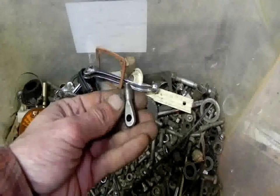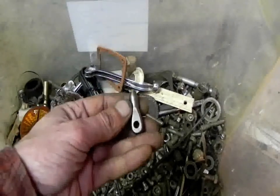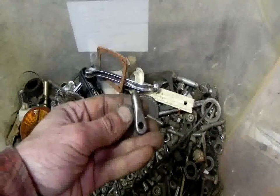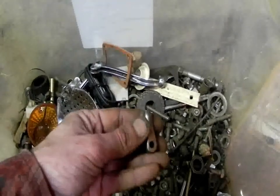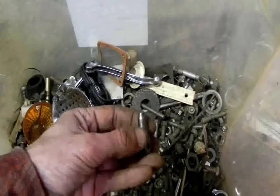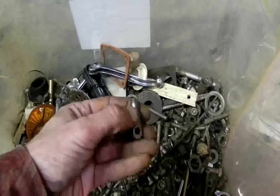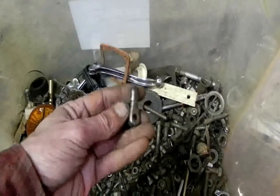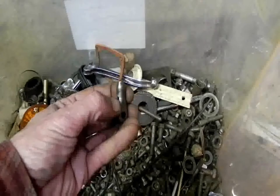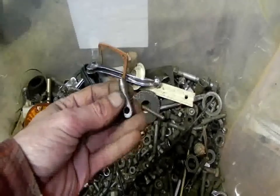I use hard solder. Medium will work, but hard solder is guaranteed to be very strong — it won't break. I've only broken cables, aftermarket cables — frayed cables that I have made because the pressures could fray the cable before they would break the actual nipple off. This one is used; I can see a little ding here. But I think I'll be making a new cable for the 441 real soon.